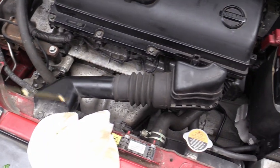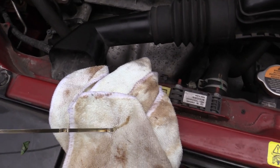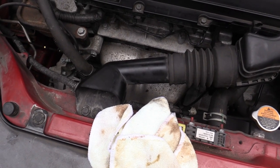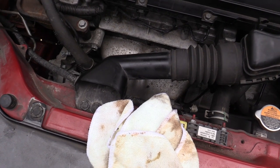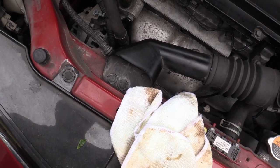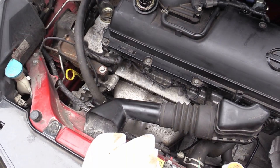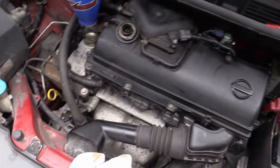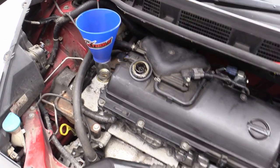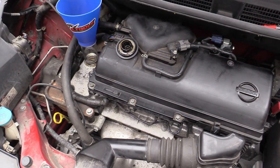Check the dipstick — I don't think you can see that but that's at just the right point. That leaves us just over a litre and a half left out of five litres which you can use for topping up. I'll just let the funnel drain down and then just the cabin filter left to do and resetting the service clock.